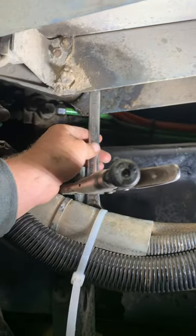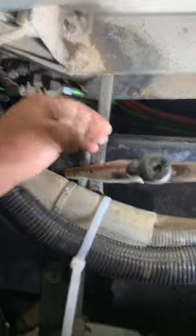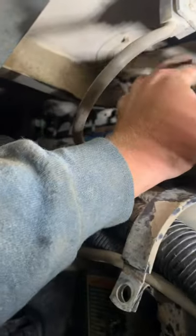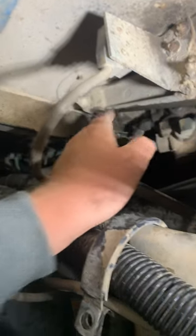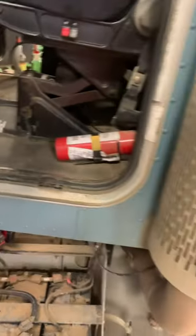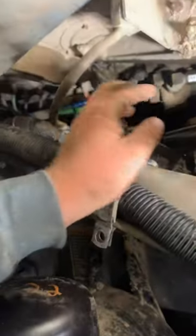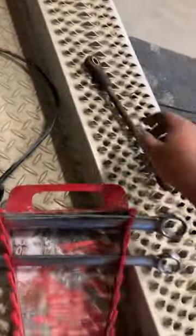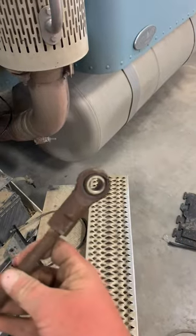It is a bolt so it does spin, so I've got a three-quarter inch on this side and I just vice-grip it to the frame. Also, as you're loosening it, your clutch pedal itself is going to want to move around underneath it — you need to force it to stay exactly where it is. At first I had a tarp strap along the pedal to hold it up, but once you start wrenching that's not gonna work. I got a vice grip underneath it; slowly but surely with a three-quarter inch ratchet wrench, work that nut off.